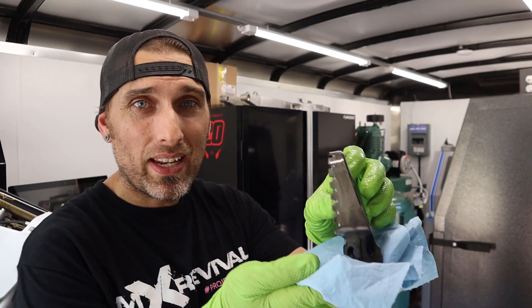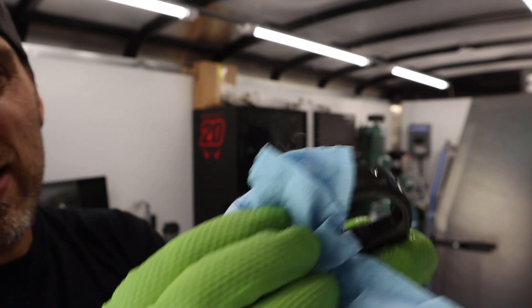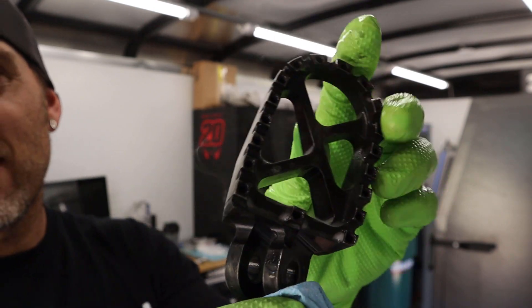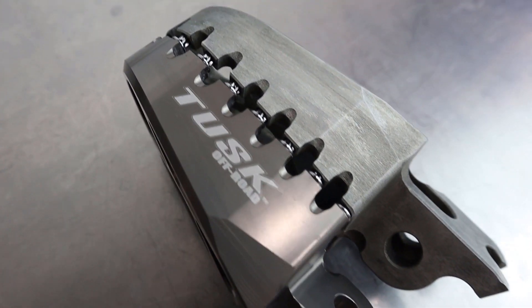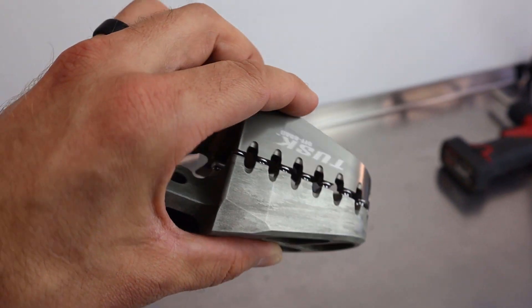It's starting to strip — next step a little more stripping and then we'll get it in the vapor blaster. Every time I let it sit, it sort of looks anodized again, but if you give it a nice rub the anodizing is coming off. That tells me it's pretty much liquefied and I can vapor blast this off now. One of the pegs is very badly burnt from the lye bath. I already filmed an alternate ending where I make you wait until next Saturday for the vapor blasting, but I just couldn't commit — so let's get these parts in the vapor blaster.